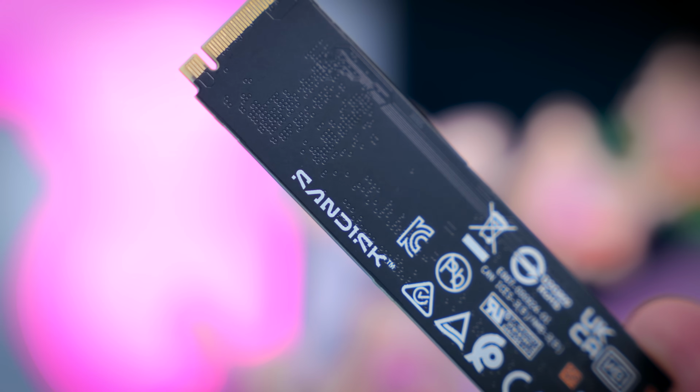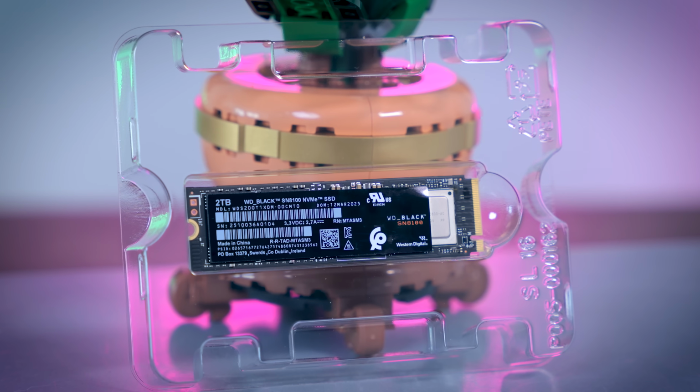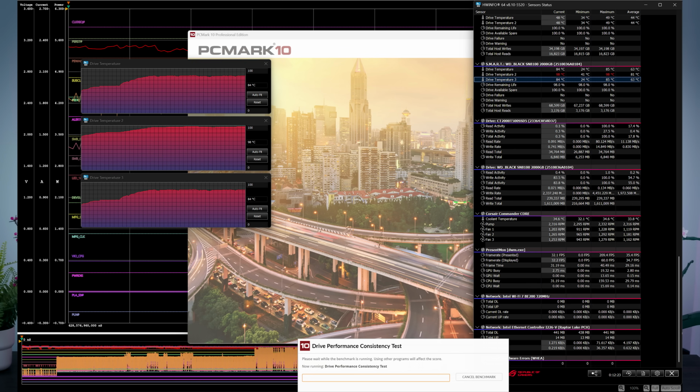Now, Sandisk is focusing on power consumption with this drive as well, and it is definitely looking like an efficiency upgrade over anything that is Phison E26 based, but whether your SSD uses 11, 7 or even 5 watts, you still want to use a heatsink because if you stress it without a heatsink, it will get really hot within a few minutes and it will start to throttle and lose performance. So you should definitely use a heatsink that comes with your motherboard, or you can buy a simple third-party heatsink for a couple of euros or dollars and you're going to be more than fine. I'm going to put some suggestions in the description box down below.